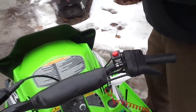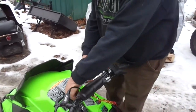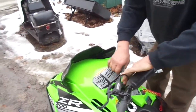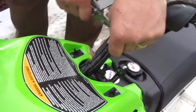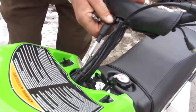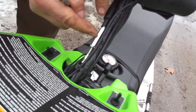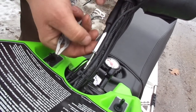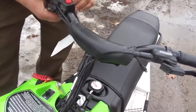To adjust that, you don't mess with anything on the carburetor. You just pop the ring of the carburetor around here, pop this wire tie off with your trusty Leatherman, and then slide this little sleeve back. And there's the adjustment to adjust the throttle cable. That's a 10mm, that's an 8mm. So you just loosen this and back this out counterclockwise until the play is gone.